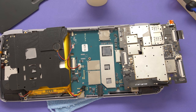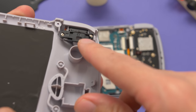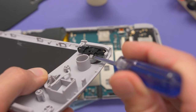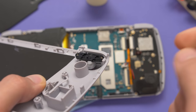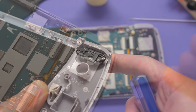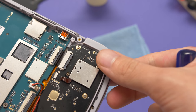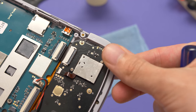They would really need to make an entirely different heatsink for the Lite, as well as a spot for the fan if it ends up needing one. While we're here, we can talk about the L2 and R2 Hall trigger. There is a magnet in here surrounded by plastic. When you use the trigger, the magnet moves closer to a tiny hole. On the other side of that hole is a Hall sensor, which can sense the presence of the magnet and provides higher analog values the closer the magnet is to the sensor.